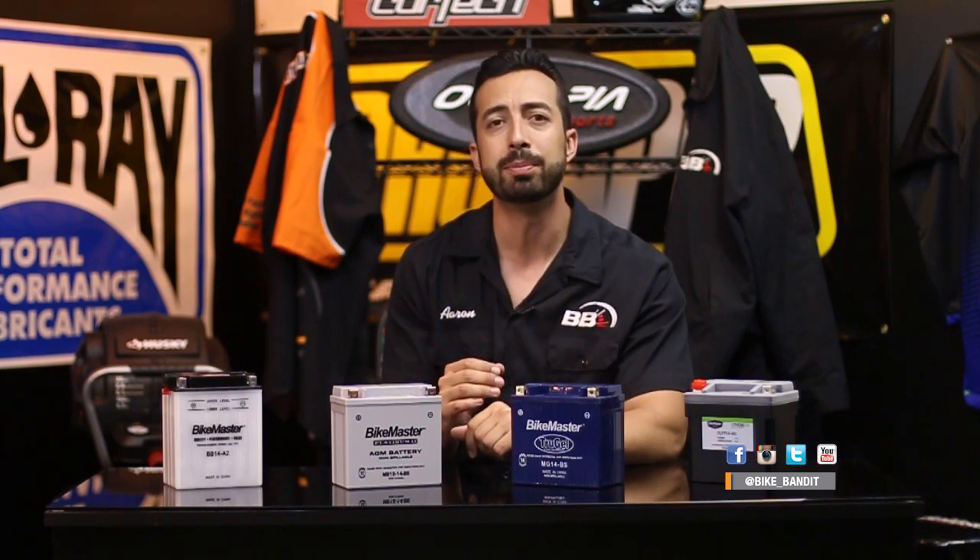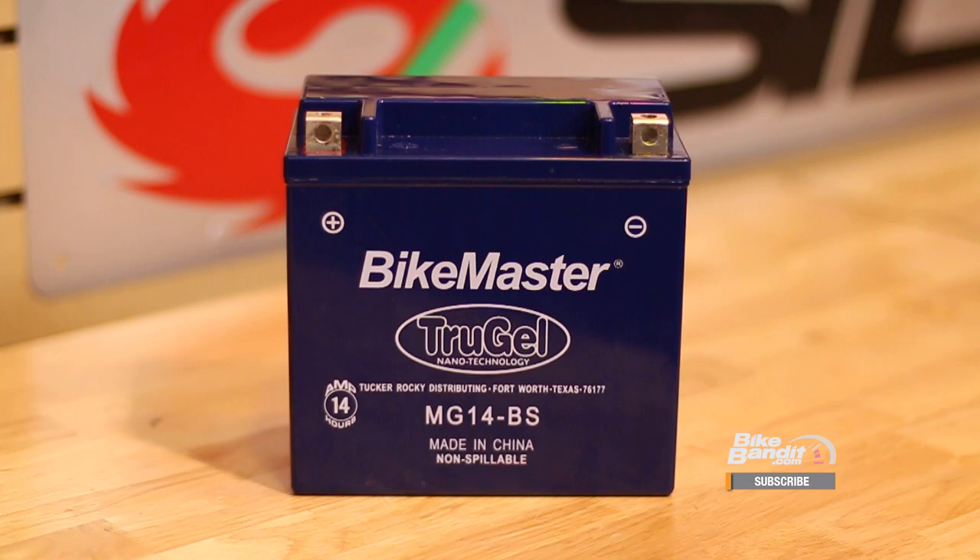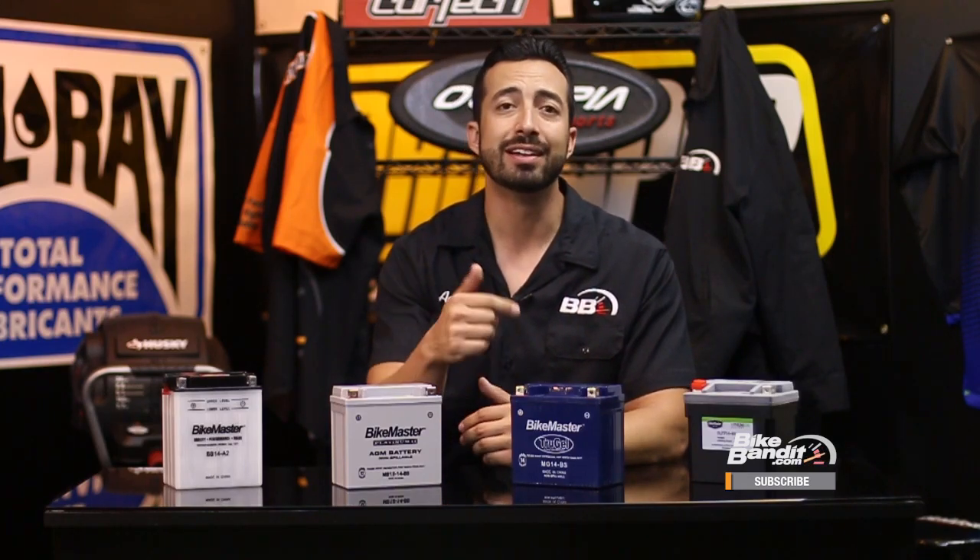While we're talking about AGM batteries, there is another variant of lead acid battery you've probably heard about — the gel battery. Gel batteries follow the same basic concept as lead acid, but the lead plates are suspended in a gel electrolyte rather than a liquid. Gel batteries are best for deep discharging, so you see them used a lot in power storage systems such as solar energy systems, RVs, and boats. They aren't really used much in power sports applications anymore, though people sometimes talk about gel batteries when in fact they're referring to AGM or sealed batteries. One partial exception is the Bike Master True Gel, which combines AGM and gel technology using a gel electrolyte captured in fiberglass mats — giving you the ruggedness and performance of an AGM battery and the deep cycling ability of a gel. These run about $80 to $120 for most motorcycles.